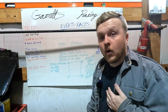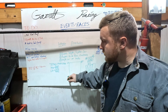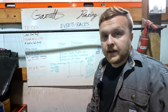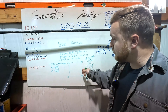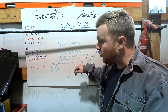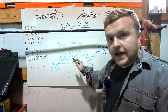To get your left side percentage — which is what we want since we're doing left-hand turns — you add up left front plus left rear, get that total, and then divide that by the overall total weight of the car. So let's say your total weight is 2,650 and when you add up left front plus left rear, that might be 1,500 pounds. You do 1,500 divided by 2,650 and that'll give you your percentage. The same can be said for the right side. For your front percentage, you do left front plus right front and divide by the total weight — the inverse of that gives you your rear. Not too hard to do.